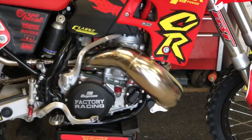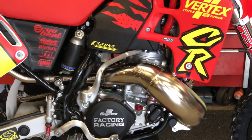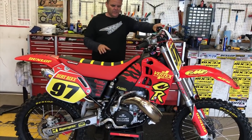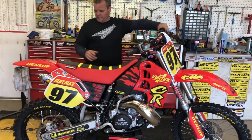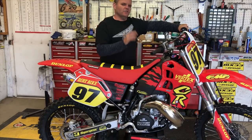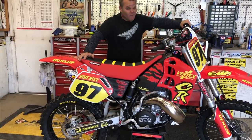The whole motor was cryo-treated — they go through and treat all the transmission and those pieces. A guy there actually assembled the engine, and then my buddy Austin, whose bike this is, put everything together and got it all ready for dirt bike magazine. We'll run a little bit of VP C12 mixed with pump gas so we don't get any detonation under some serious big hill climbs.